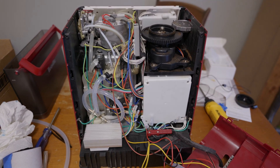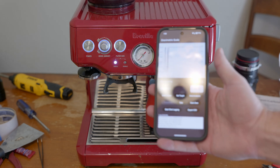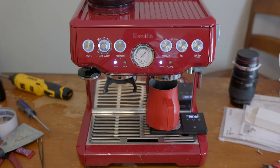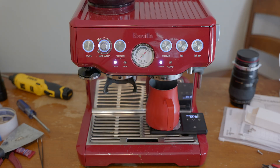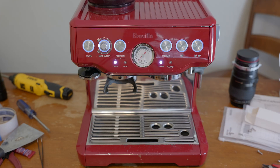Got her wired in — time to do some tests. Firing up the app, I've got this thing set for 42.5 grams. I don't have the portafilter in it; I'm just going to do a water run to see how it goes. Taring the scale now. Starting a shot. We got 43.3 grams. This is not tuned for this machine — I've got it tuned for my own espresso machine — but it's not too bad. That's a little over half a gram off, which is not terrible at all for a first run out of the box.